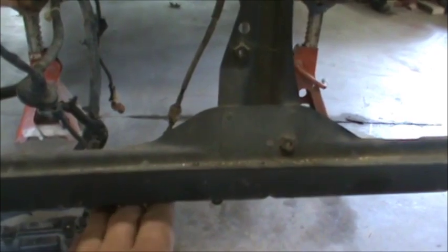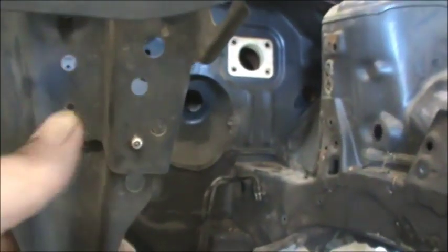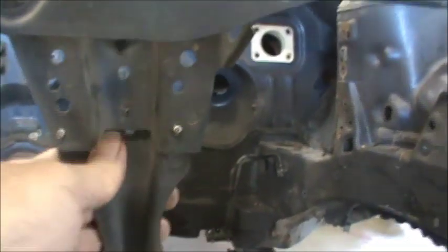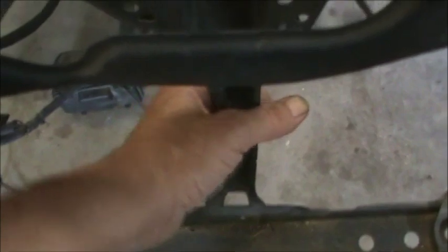I've got an issue here with my core support — hopefully you can tell, this is bent right here. Something has hit it. See if we can get some sort of a straight edge here to get a look at it. You can see it's bent, something has hit it. Here's a kink right here — I don't think that's supposed to be in there. I'm gonna take it out regardless. Up here, this is pop-riveted to the top rail here — we're not going to go for that for sure. It's kind of bent out, rolled out a little bit, so I just need to do some straightening here.